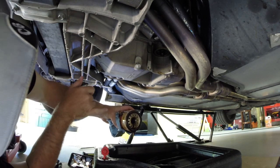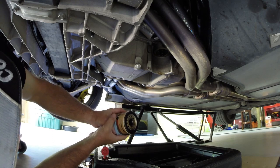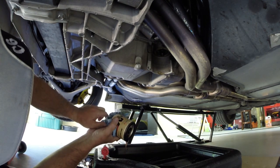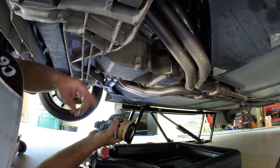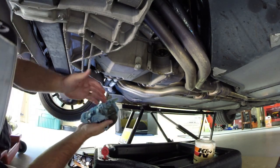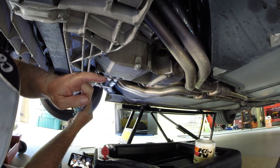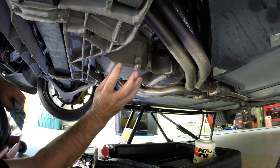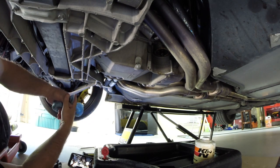When you're changing oil, there's a gasket on the bottom of the oil filter — make sure that comes off. If it's not, it'll be stuck to the bottom of the block. If you don't notice it's there and you go to put your new oil filter on, it won't seal. As soon as you start the car up, it'll allow that other gasket to spit out of there and dump all your oil on the ground. So watch out for that. Also, when you go to put the new oil filter on, take a little bit of oil and lubricate that seal — just run your finger around it. That way it'll seal up a lot better and you won't have any leaks.